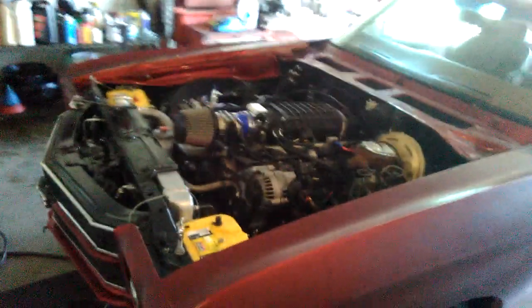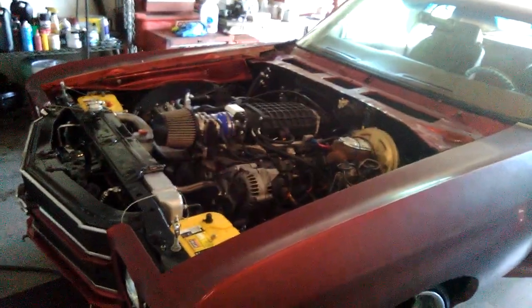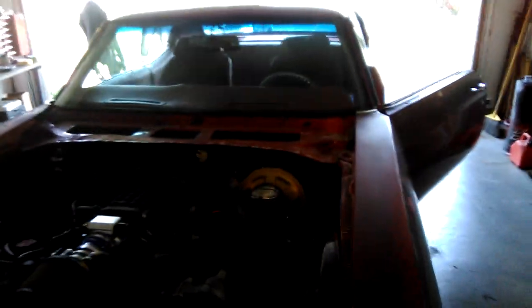So I went ahead and wet sanded the whole car. The body is in good condition, so there's a nice base here. Whoever did the paint job last time did a nice job. There's a sealer, a primer, and then the silver base coat, then the candy apple red, and then a nice clear coat. We sanded everything down with 1200, and did a couple repairs where necessary, and we're just going to go right over that existing foundation. So everything should hold up real nice.